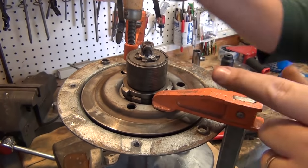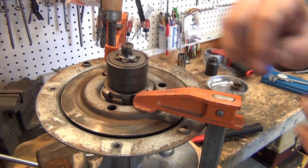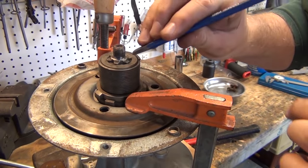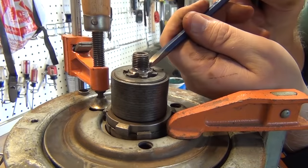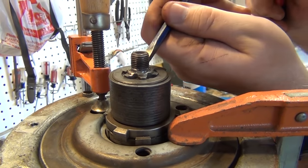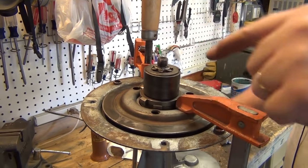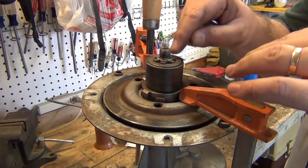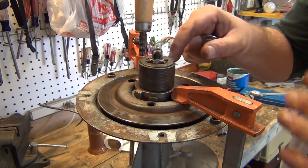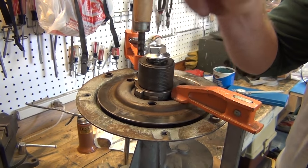Now the top of this clutch assembly goes on — add a little grease to that. Make sure you get this on, kind of line it up with those bearings and with the sprocket basically at the top, and then it should just tap on. So we got the clamps back on in our jig so that we can put the disc brake down a little bit with everything assembled in the correct position. We don't want to chisel it down much because this is supposed to come back up, but we just want to try and crimp it a little bit with a cold chisel to keep it in that position. I worked all the way around with the cold chisel, but there isn't as much metal because I had to grind it off. It's just supposed to be crimped just enough to keep this retained so this doesn't come apart and your clutch bearings fall out. When we put the pulley on with the motor nut, it'll hold it all in position and in the proper spot anyway.